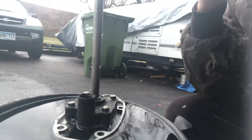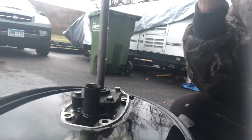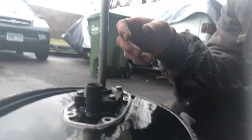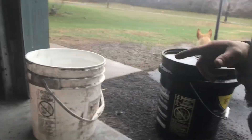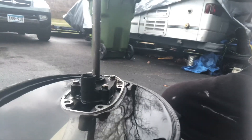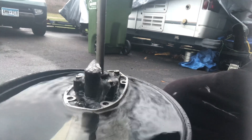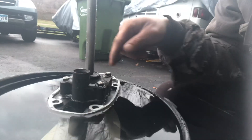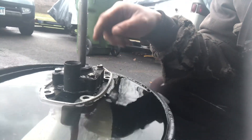When I first tested it, the water pump wasn't pumping water. Then I remembered from the video that these pumps are not suction-activated, so you have to submerge the pump under water. I ended up taking a bucket, pouring some water in so the pump was submerged — that's when it activates the system to suck up water. I took it back out, and this time it worked right away.